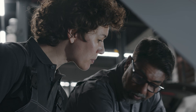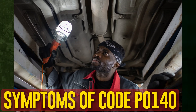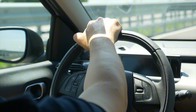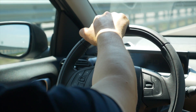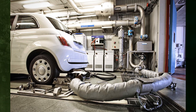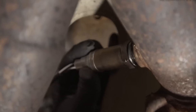Now let's talk about P0140 symptoms, causes, and most importantly, how do you fix it? The check engine light will appear if your car has the code P0140, but it's likely that you won't experience any other symptoms. You won't become aware of an issue until your car is taken in for an emissions test. Most emissions testers will automatically fail a vehicle with a check engine light from an emissions component. Since the oxygen sensor is a component of the emission system, an automatic failure is nearly always the result.